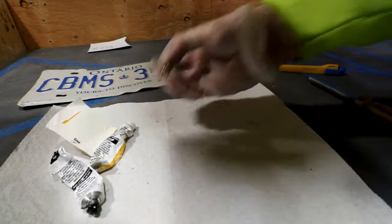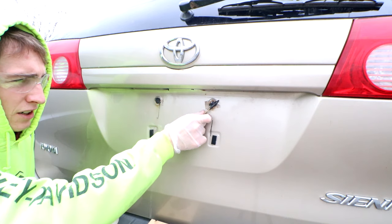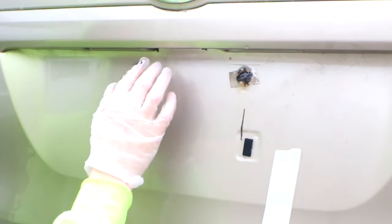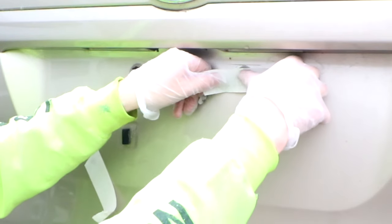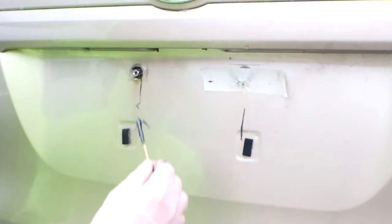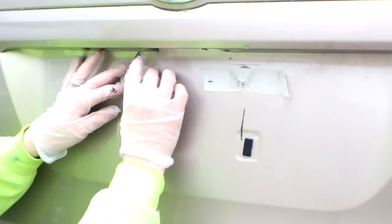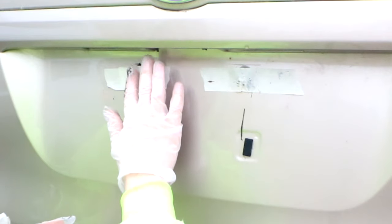We're going to take the two nuts. I'm going to take a little bit of this epoxy on the screw and make a flat surface — not too bulged up because I don't want it to ooze into the center of that nut. Two pieces of tape. We'll just gently set that nut right there. Now that I've got them where I want them, I'm going to put a little piece of tape on it. I'm going to put some more epoxy around the shoulders here. This doesn't really have to look pretty because no one's ever going to see it. We'll let this sit — it says it sets in six minutes, which is pretty awesome — and then it cures in four hours, so we're going to leave it and come back.